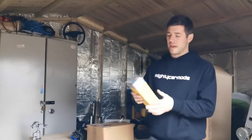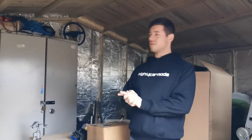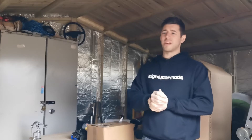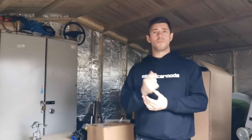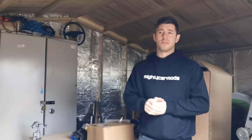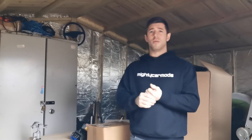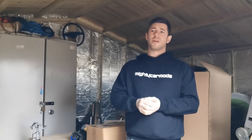So in this video I'll be swapping from these old coil packs with HT leads — a bit of an old-fashioned mid-90s design — to these NGK coils from an Audi R8, a coil-on-plug conversion. It runs a custom harness I bought from Alex Hickson, who also provided the coils. I'll show you how to fit them, wire the harness in — which is a doddle — cut the ECU case a little, and get the map done. It's changing from wasted spark to full sequential.